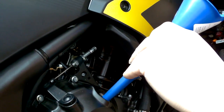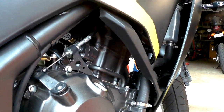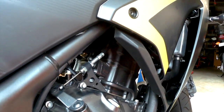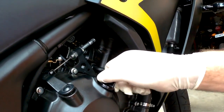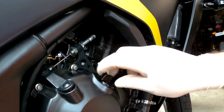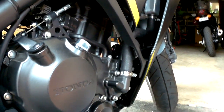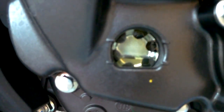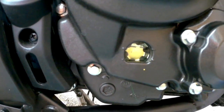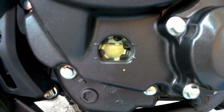And that is the last of the oil. Grab the cap and put that back on. And there. So if we take a look now at the oil gauge, you'll see that there's the oil. You won't really get a true sense of how much oil is in there until the bike is tilted, just like that. So we're good. It's enough oil in the reservoir.